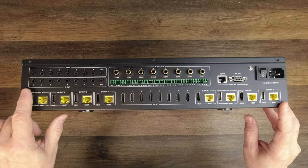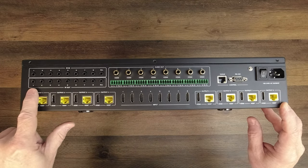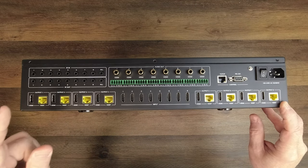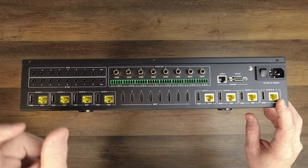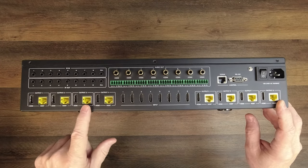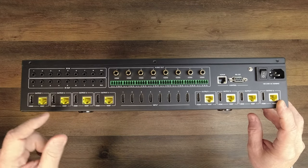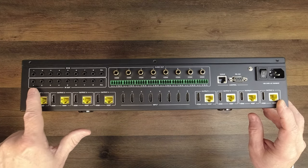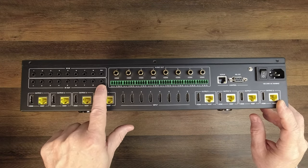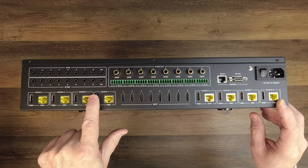On the rear of the unit where you'll make all your connections, starting in the upper left hand corner you'll find a bank of nine ports labeled infrared in, and below that another bank of nine ports labeled infrared out. These are used with the infrared blaster kits included with the product. Normally you'll connect the larger module at the remote receiver location to collect all those remote control signals and send them back to the primary location to be rebroadcast out of the transmitter module plugged into the corresponding port. The reason there are nine of them is because you can plug just one transmitter module in and every remote location can control the media if you're sending it to all locations simultaneously.